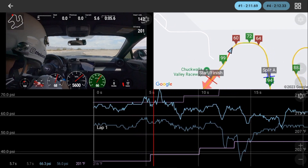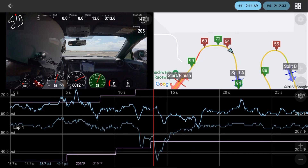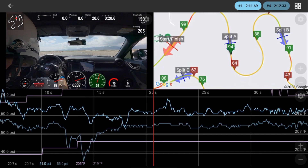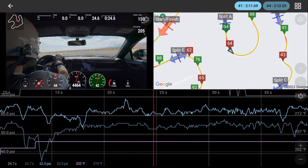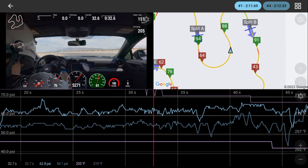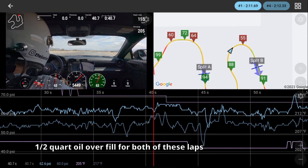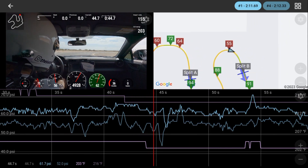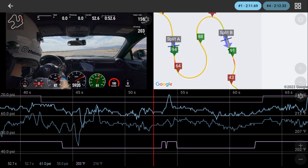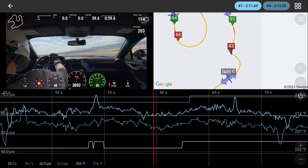The delta between the brighter blue line — our first lap out with lower oil temperatures — is quite a bit higher than the darker gray line from four laps later with about 219 to 220 degrees Fahrenheit oil temperature. Note that this lap was done during my third session where I had an extra half-quart of oil added. Going through that T6 and T7 section, we see a drop with the warmer oil, but with the cooler oil the drops are not nearly as bad as they were at the max fill line. We'll go into greater detail on the difference between max level fill and a half-quart overfill in the next section.